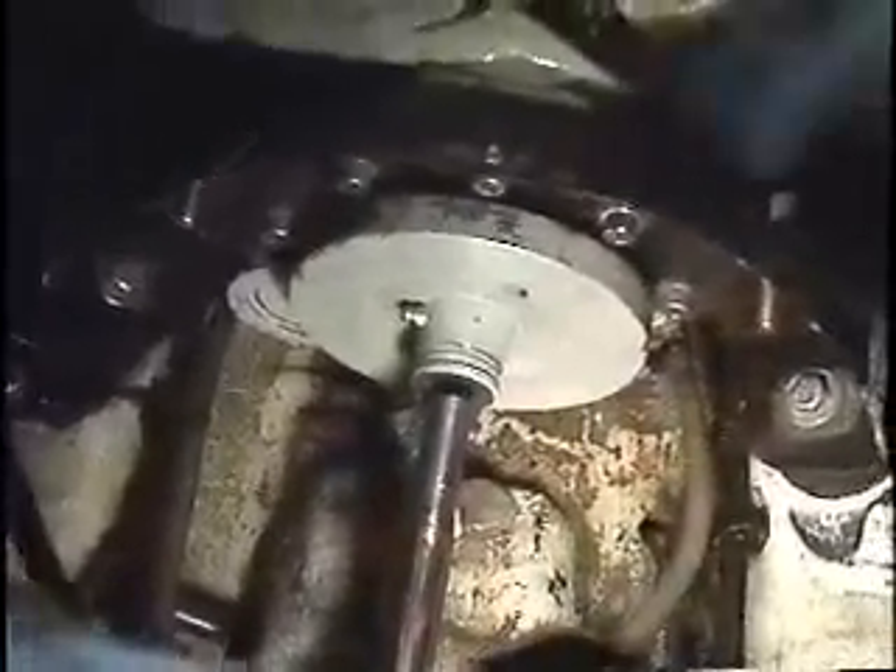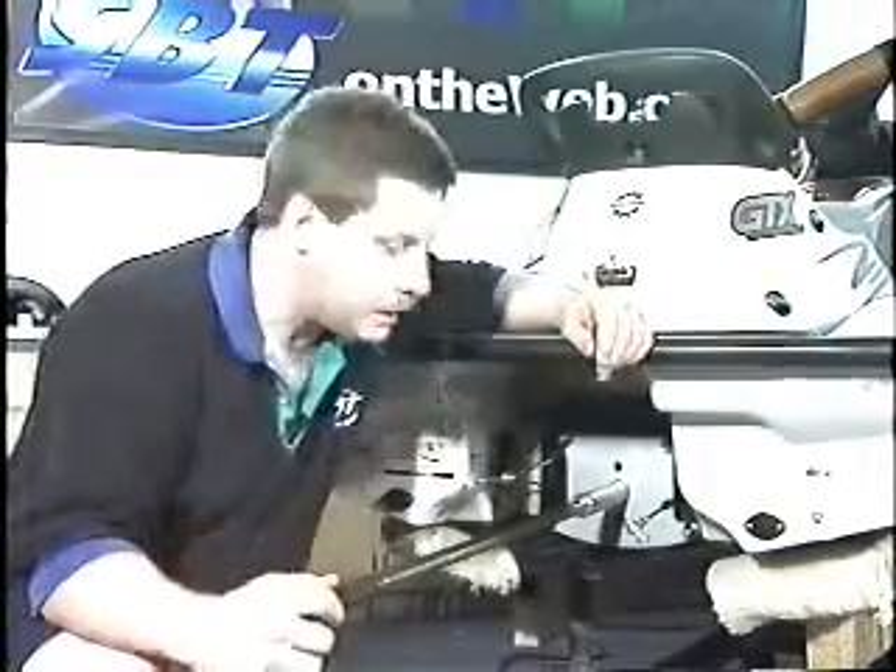As we can see here, our PTO flywheel does not line up with our shaft of our alignment tool — it's a little bit too low. So in order to correct this, we will have to use a shim and place this shim between the rubber engine mount and the engine bracket. Now that you've shimmed your engine, run this shaft in and out to make sure that it goes all the way into the PTO without binding.